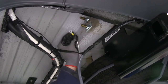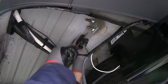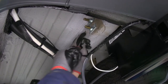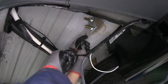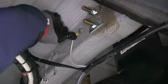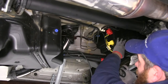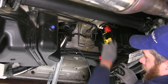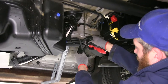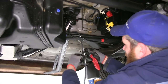We've got our ground wire here — we want to get this connected to our frame. This one has quite a bit of undercoating on it, so let's scrape a little of that away to ensure a good connection to the metal below. That should be tight enough so when you try to move your ring terminal, you won't be able to. Once we get up underneath the driver's seat area, we'll see the bottom of the battery box — that's the 12-volt connection we're going to be using. We need to separate our wiring at this point because we still need our white wire in the passenger compartment.